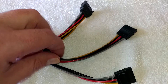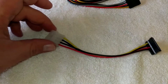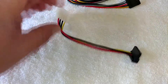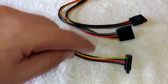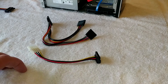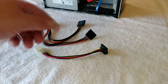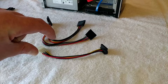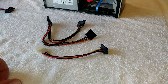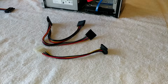What I really want is a cable with a straight connector on one end and a left-hand 90 down here for the other drive, and I couldn't even find one of those. So what we're going to do today is make our own. This is the original one from the first video that has a straight end for the SSD, and this is a left-hand 90-degree power adapter intended for AT-style power supplies, which we don't have. I'm going to cut one end off, solder the other end on, and we'll end up with what we want. I'll put links in the description for the soldering station and other connector options.